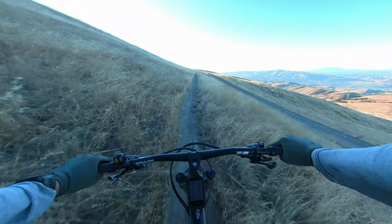You know what? Maybe, I know my tire pressure is already low, but I can't believe I want to put on the other air shaft again. The 130 was good, but it's the mod that I did, it put too much negative air. So when I hit big dips, I get sucked into those dips. Like I'm getting yanked towards it when the bike goes in the dip.